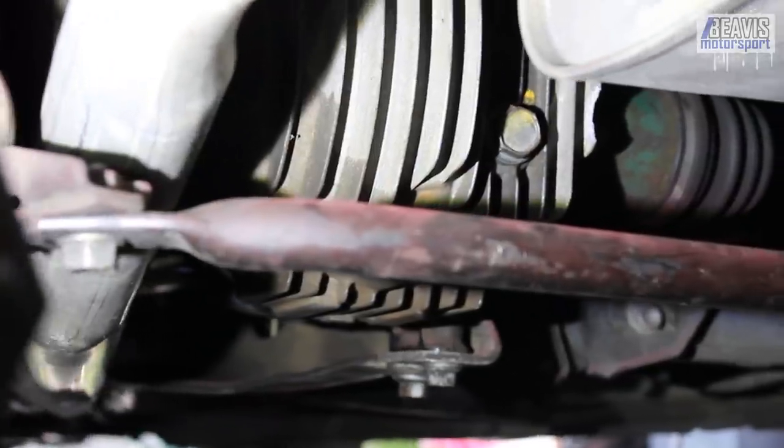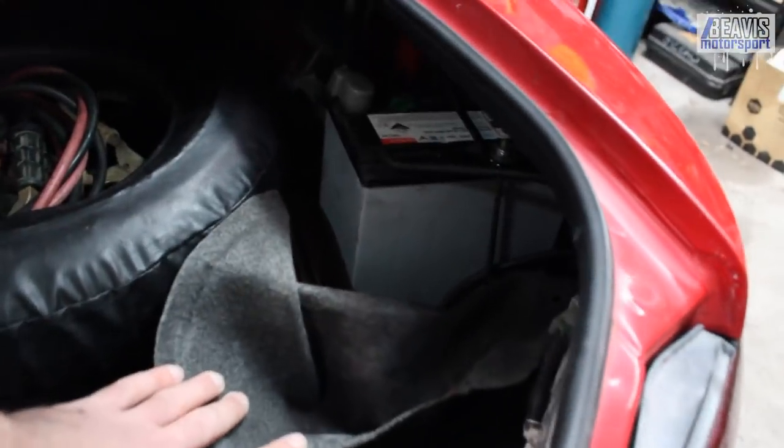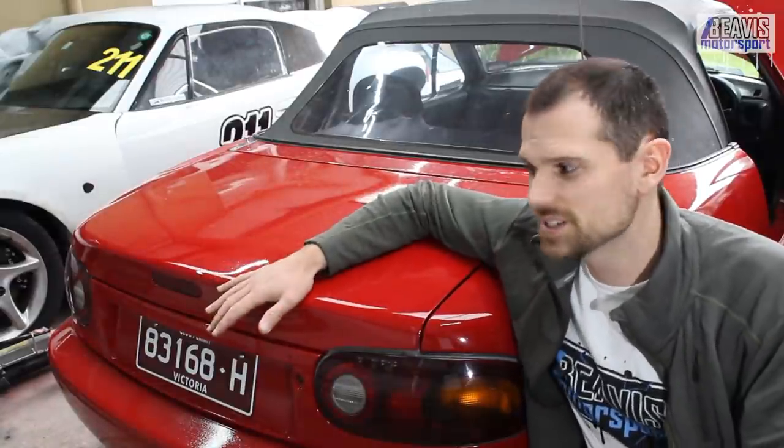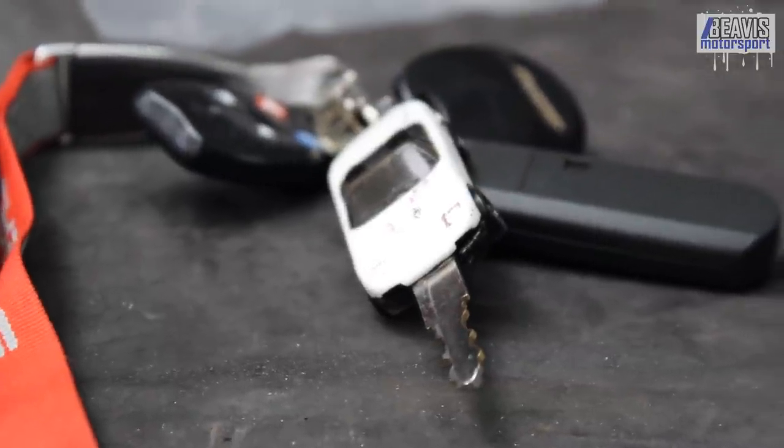A final few things to mention: have a quick look under the rear of the car for any leaks around the diff — the seals in those can start to fail occasionally. Have a look in the boot for the battery and make sure it's an AGM (absorbed glass mat) battery, not a typical lead acid. And consider the seller — are they a bit weird or shifty? Can they not answer your questions properly? If you're not trusting them, just walk away and find another car. Overall, a Mazda MX-5 is a fantastic, reliable, cheap, and efficient car — super fun to drive and great track cars. Really the only thing that kills them is not changing the oil or not keeping up coolant levels. And finally, when you buy the car, ask the seller for any extra spare set of keys — it's very possible they'll forget about the others.